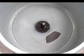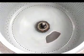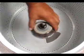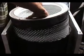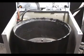Remove the spanner nut and this cone-shaped piece. Grab the spin drum and take it right out. Now be careful because it's pretty heavy.